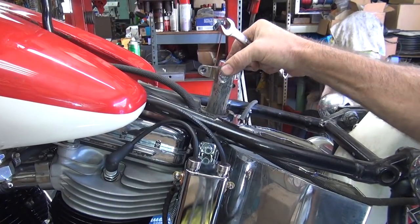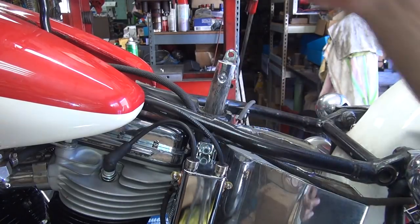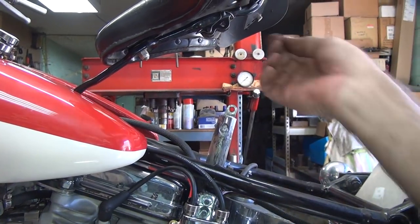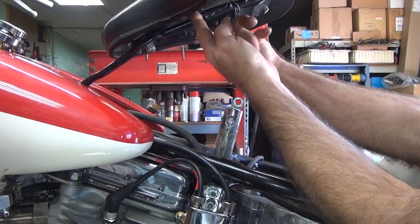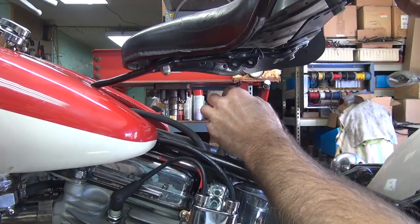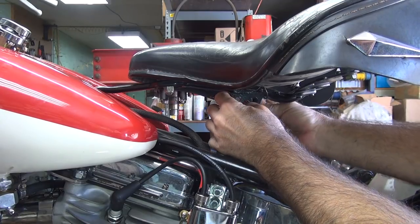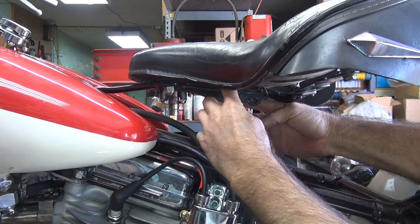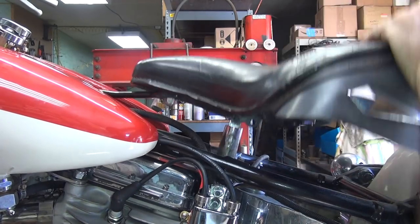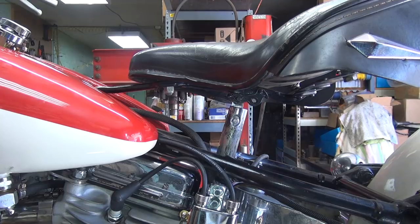It's got factory clearances on here - nice and loose and dry. I'll be able to lube the damn thing. So there's the pin that goes through here - pin's in the bottom of the seat. You've got your pins right here held on this little spring. Your pin has a little clip groove on it. You go right until it lines up in the hole, put the pin in and put the spring down like that. That's what holds it in - so now it can't fall out but you've got quick access to it. It all goes up and down like it's supposed to.